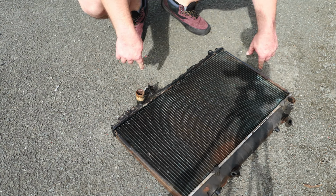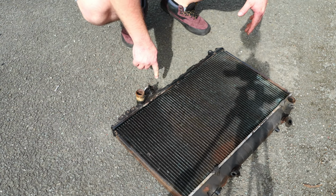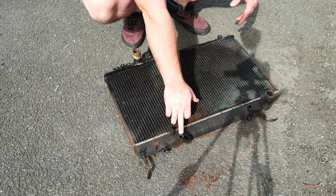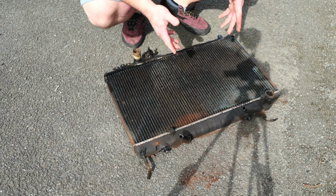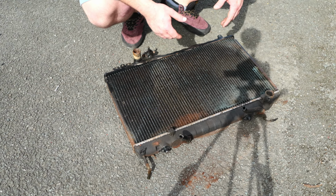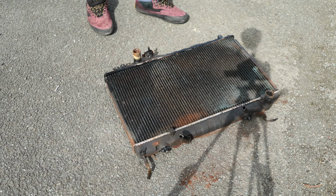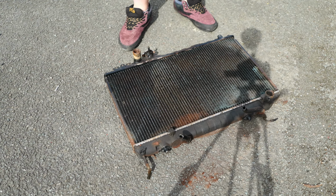Here we go. So here it is. So coolant in and out. Obviously overflow from where the radiator gets overwhelmed. But then you've got these two down the bottom, which are, what, oil in and out, Tim? I guess. Auto transmission fluid. So it doesn't have a separate cooler for that? No. So they have the same radiator on manuals. No, the manuals don't have that bit in it.